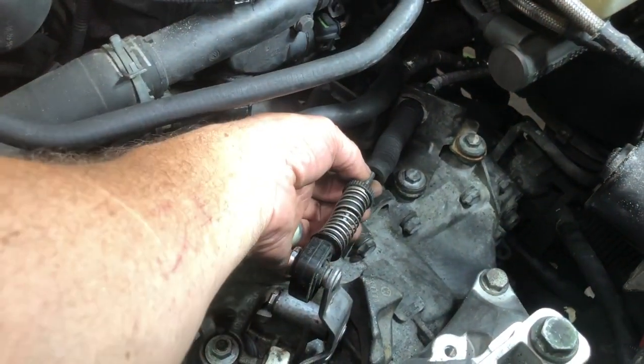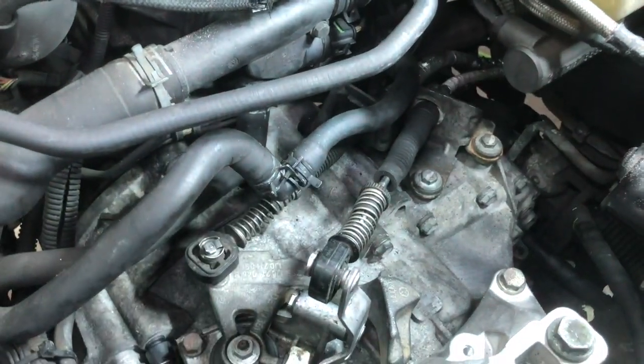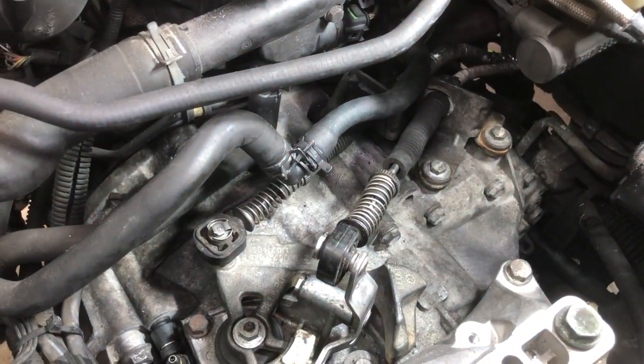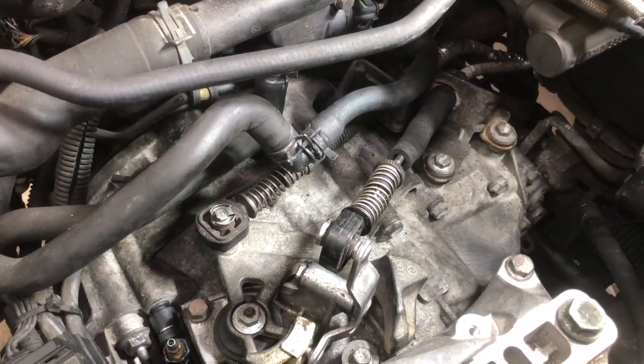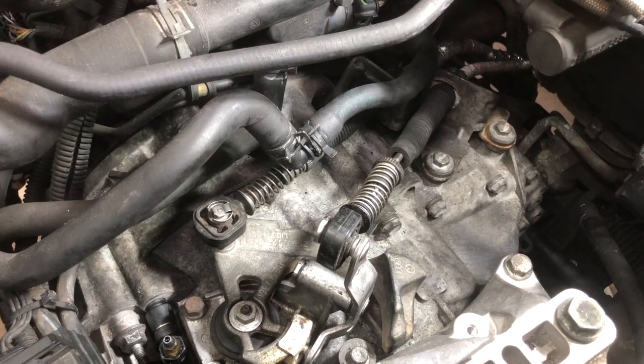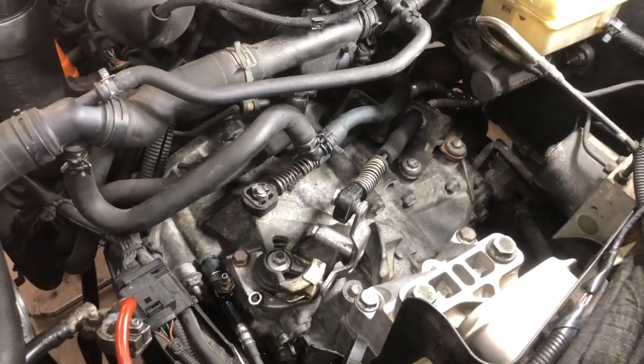Try pulling the slack out or in as you pop that spring, and that little bit of slop sometimes will clean it up and so you can make it fit just perfect. But two or three times you ought to have it just perfect, and then you are set on your shifter.